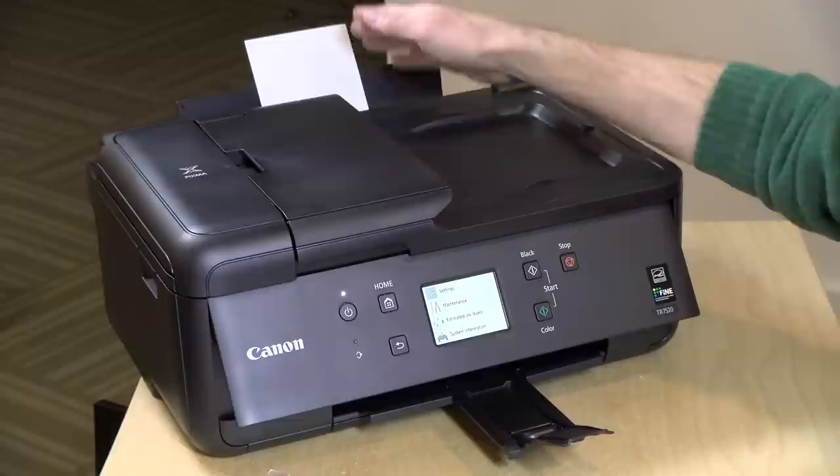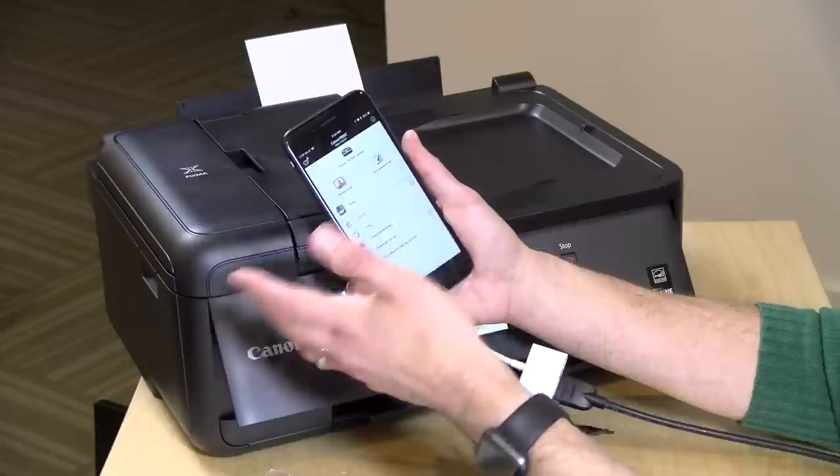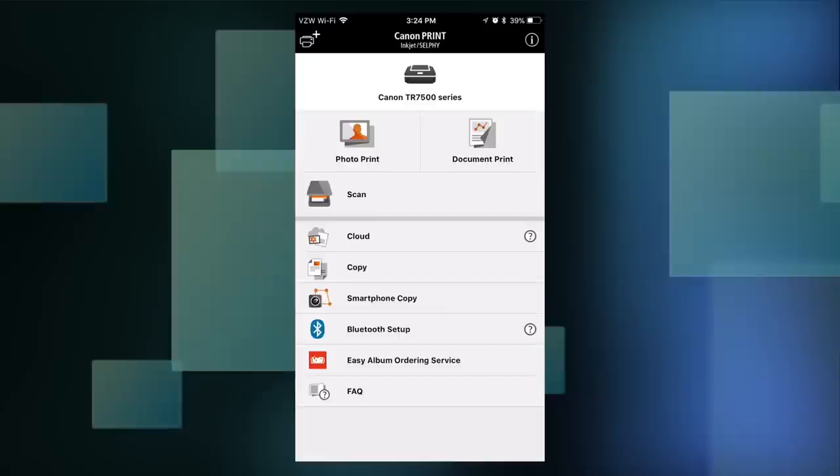So let's shift gears to photo printing. This printer has five inks and can print edge-to-edge on photo paper. I've got a 4x6 blank sheet loaded in the manual feeder, which is the better spot for photo paper. You can print edge-to-edge borderless on a PC or Mac if you have the drivers installed, which go in automatically. On mobile devices like iPhone and Android, you need to make sure you've got their app installed to get borderless prints, since the Apple printing driver doesn't support borderless prints through photos — you have to go into the app. The interface isn't great but they've made it somewhat easy to get your photos selected.